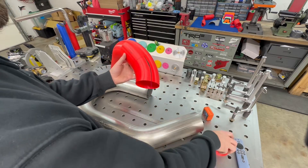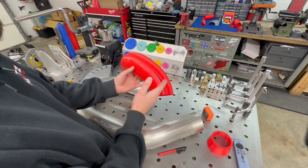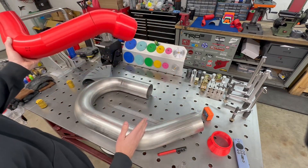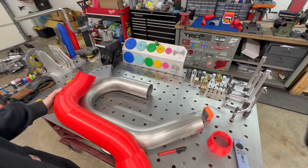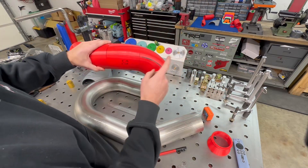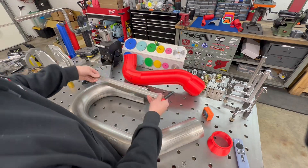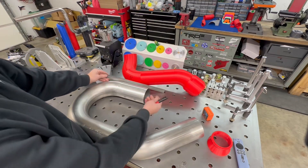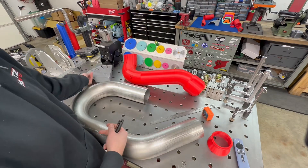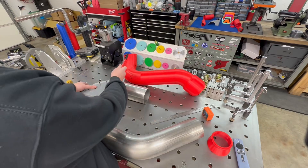We finished the 3-to-4-inch transition, so I took that off my template. I've got a 6-inch centerline radius, 45-degree bend here and here, and I've got my stainless J-bend from Vibrant. I know this side is longer so I'm going to match it up with the other side. To do the next piece down the downpipe, I'm going to use a steel rule, line it up, and as soon as it starts to bend that's where I'll mark my tangent line. Then I'll use my little jig to get my 45-degree line perfect and get this second piece tacked in.